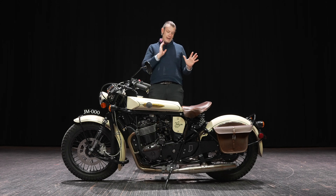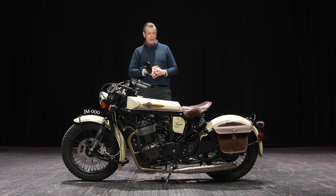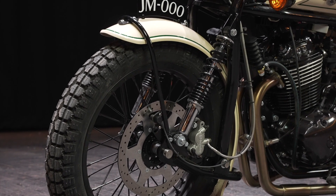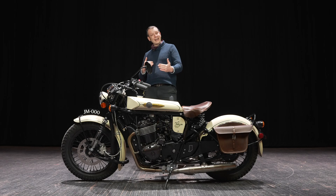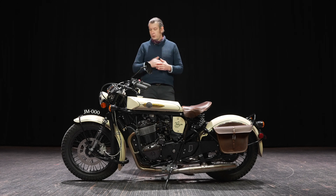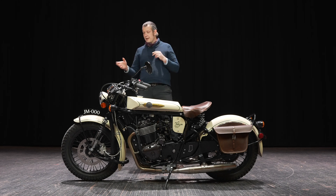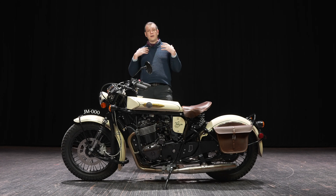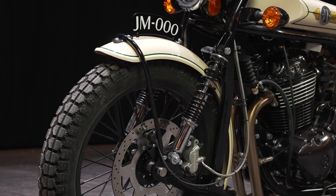Paired with our leading link front suspension, the shocks are also by Icon. That front suspension is almost identical to our 250 suspension and actually shares the same shock absorber. Those shocks really work well. We did widen the forks to allow for our wider tires, rims, and wheels. These are 18-inch front and back, just like the 250, however we've gone up to 2.15-inch rims, which allows us to run a 3.5-inch tire on the front and a 4-inch in the back. That's still a lightweight, narrow tire suitable for this lightweight bike, but it gives you more tire options and a bigger contact patch.